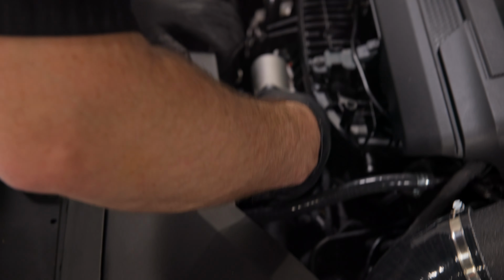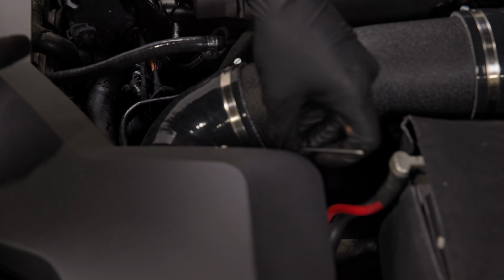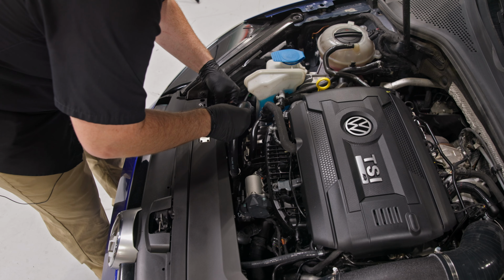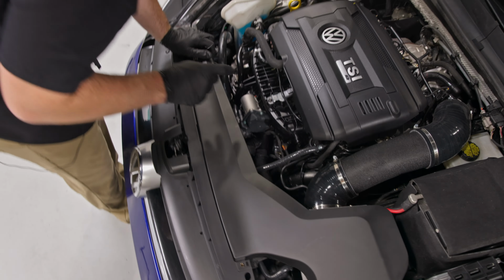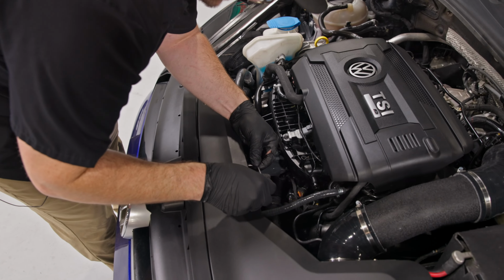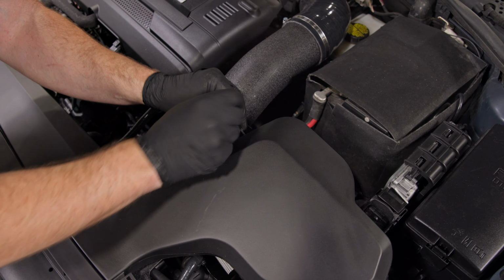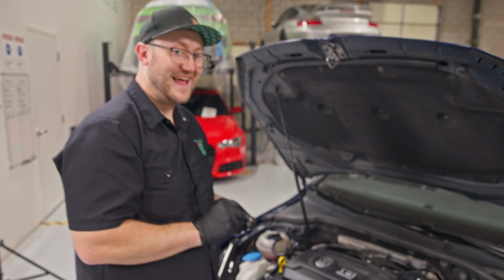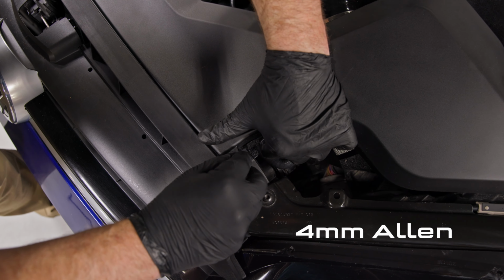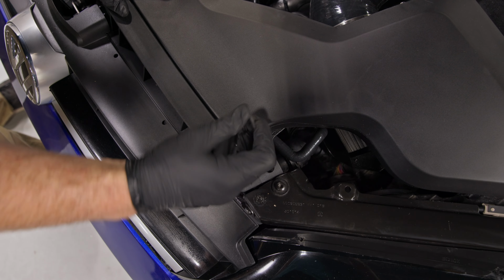Once I have all the bolts in, I'm gonna start from the center and get them nice and snug, going crisscrossing my way through all of them. Once I've kind of cross-hatched all of them, I'm going to go through one more time and just make sure they all are nice and snug. Don't wrench on these crazy hard. You don't want to strip them out. But they do want to be tight enough they're not going to rattle out. The last step is one more bolt. Now keep in mind, if you don't have an intake lid, there is no mount bolt on this side.